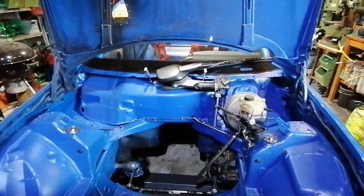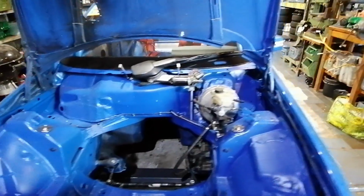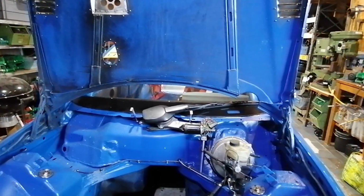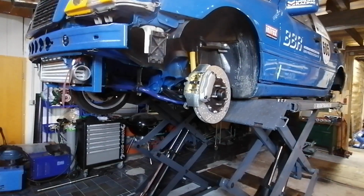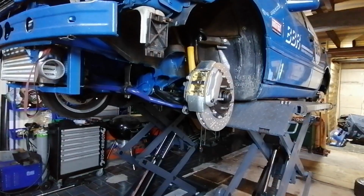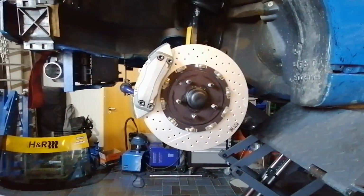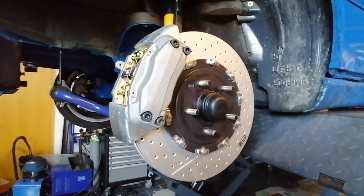But I think this is mainly it which can be seen from the top, so I think it's time to lift up the car and I will give you more details on the axles and suspension. Now you see more of the major changes. My goal was to make the car more direct and stiffer and also lighter. So I changed the brake system. This is now a disc with an aluminium inner element, which saves a lot of weight.